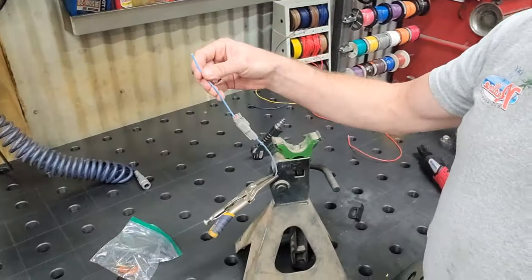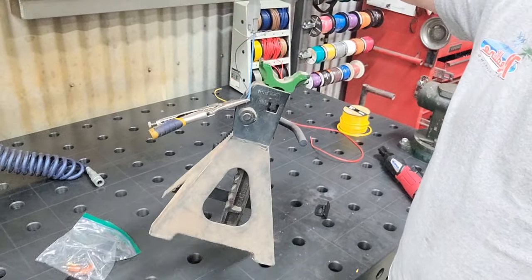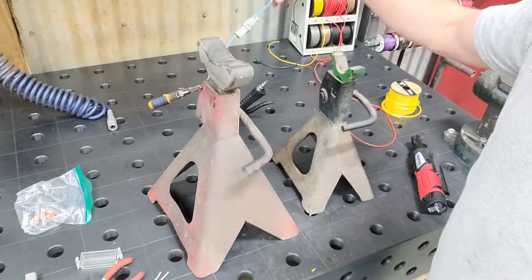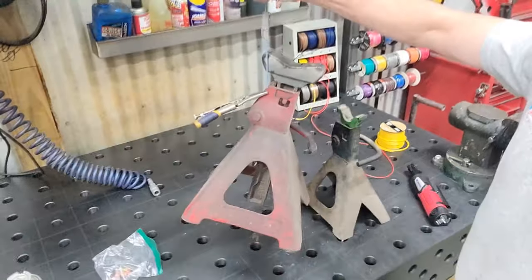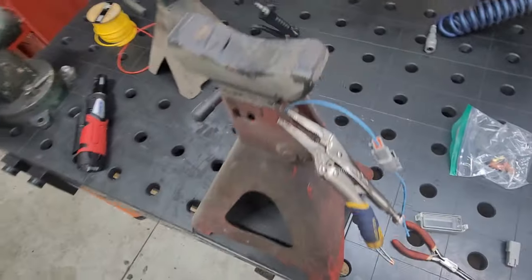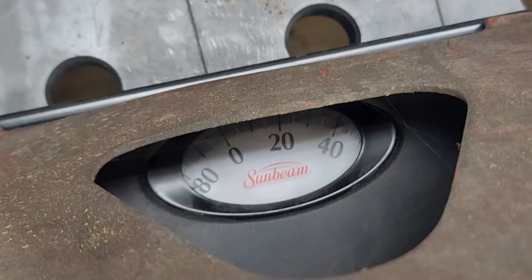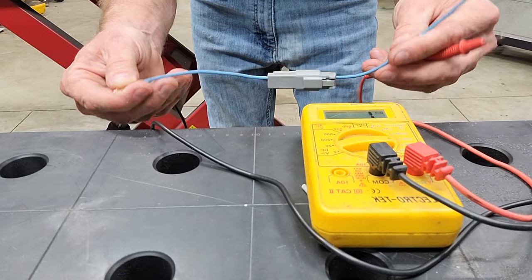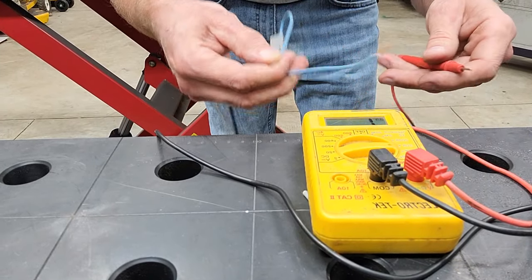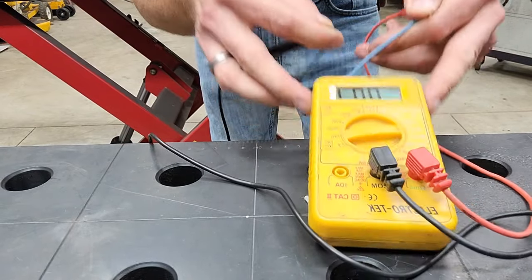You guys know what a jack stand weighs. I've got my little Deutsch connector right here clamped to a jack stand — let's see if I can pick it up with that. Not bad! Let's get something heavier. I found a much, much larger jack stand — let's see if I can pick this thing up with it. Wow, that's pretty impressive. Let's see exactly how much tension we put on this thing trying to pull it apart — got it on my little scale. It's about 15 pounds. After mistreating our little connector here with 15 pounds worth of tension, I'm going to go ahead and check it for continuity. If everything is still connected inside the connector, that one will go to zero. And there we have it.